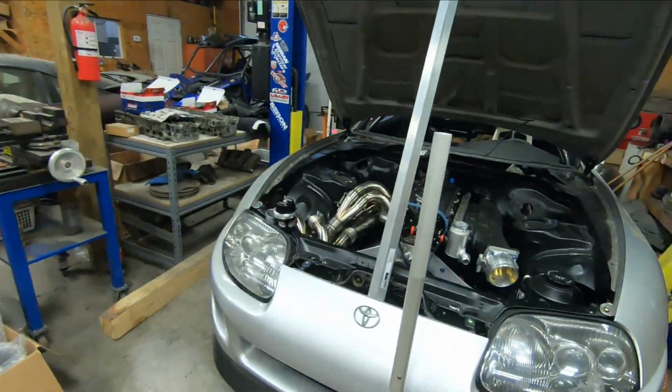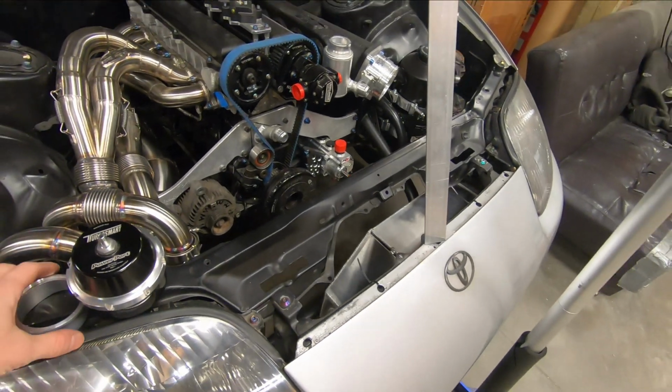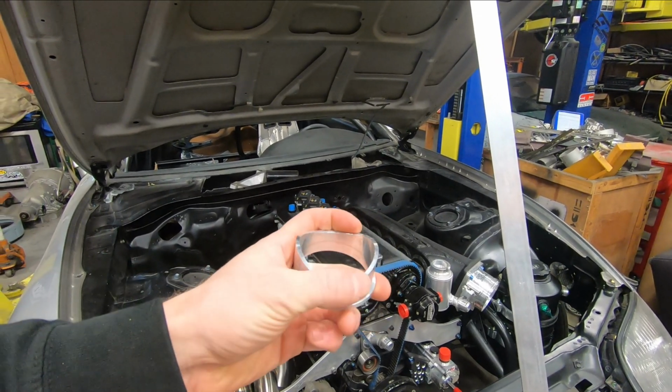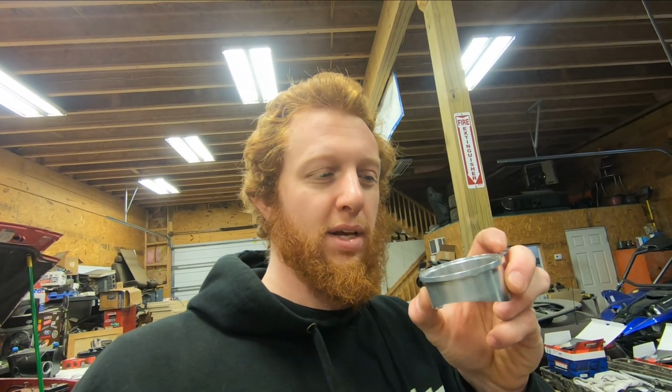So for now, I need to drop the intercooler out of here. I need to remove the coping on this flange. As you can see, it has this curved notch in it, so it'll fit better on a piece of tubing. I don't need that if I'm putting it on a flat section of sheet metal, but I'll drop the intercooler out. I'll modify this flange so it sits flat, and go ahead and punch the hole in the intercooler core, or in the intercooler end tank rather, weld this up, and then the tanks can be welded to the core.